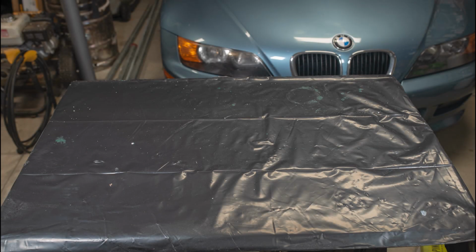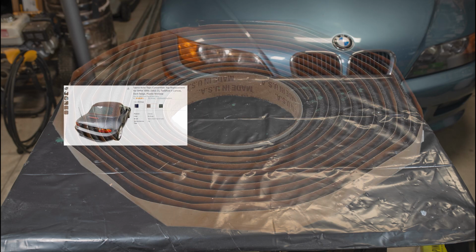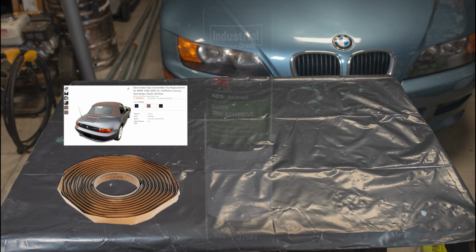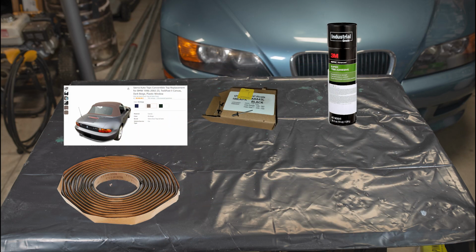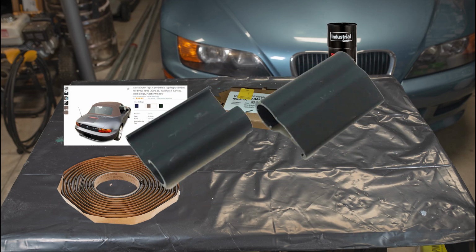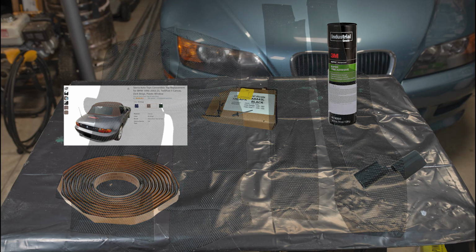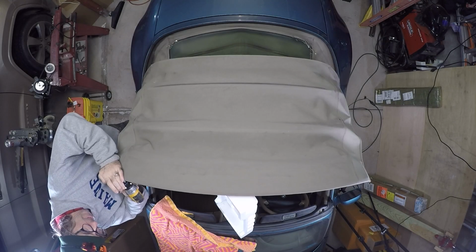To complete this project, you'll need, of course, a new top. The one I got was from Sierra Auto Tops and is great quality. You also need the 15-foot 3M window weld ribbon sealer kit, some trim adhesive, some black domed head rivets, and I would recommend a new set of covering caps as mine were brittle and broke very easily when attempting to reinstall them. Depending on their condition, you may also want to get a new set of tension straps. Like the tools, I've put links to all of these items in the description below.